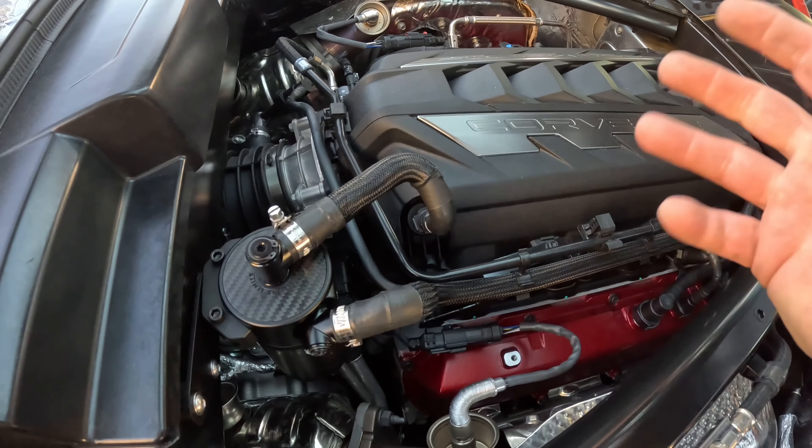We're trying to get this tube out — and it's already loose, falls right out. Thanks GM. Here's the new hose; we're gonna run it down and connect it over to the catch can. We've got the inlet ran, comes all the way down to the new bracket which clips down there. The top connection is easy — put it on, they clip in real easy. Take the old clips off the old tube, clean that up, and we can final tighten everything up in orientation.